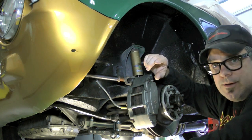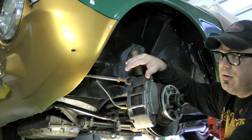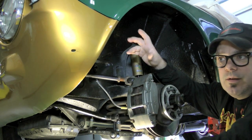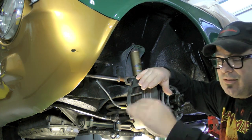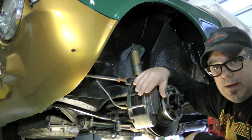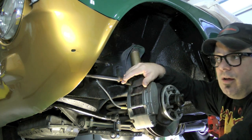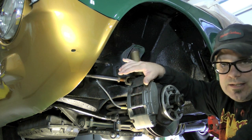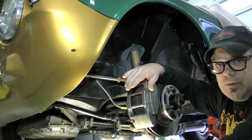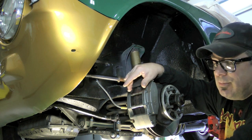Lower profile tires on fairly wide rims - like a 6, 7, even 8 inch rim - if it's a low profile tire, that camber can somewhat exaggerate the contact patch of the tire to the ground. That's just something to know. We won't get into the science of that just yet, but that is coming up. We have a couple of big race events we're tech supporting where we can use some of that video to explain it.